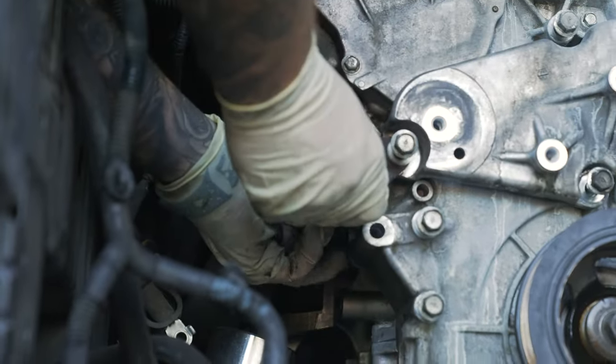You want to make sure that you have slack on the chain. When I took the tensioner off and we're still on time, we're good. Just pull the chains off — find out where it wants to come off, which is on this right side over here. All right, so we got the timing chain off, tensioners off, guide off. Now we're going to pull the tensioner arm off and then we'll be able to pull those gallery gaskets off.